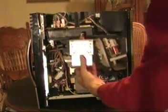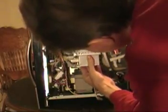Here's the business side of the microwave with the cover off, and it looks the same in all regards. There's a thermal sensor you need to pull off and transfer to the new one. To get the existing magnetron out, there are a couple of screws accessible through holes — nice of the designers to do that — and a couple on the other side, so basically four screws holding it in.